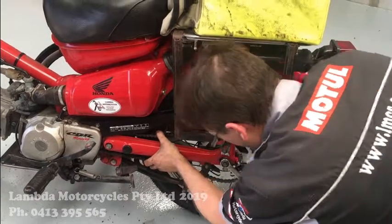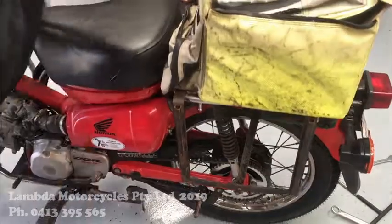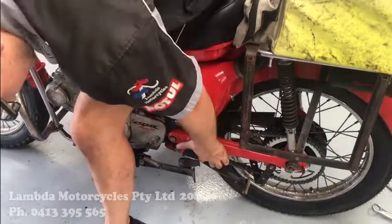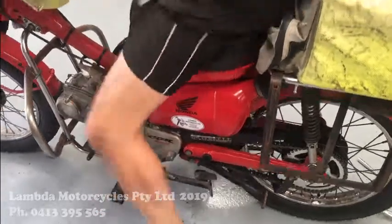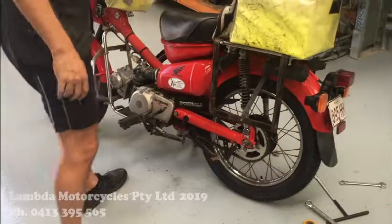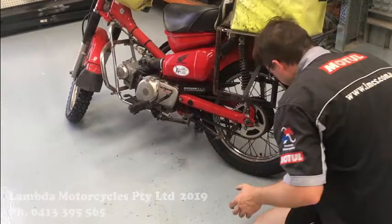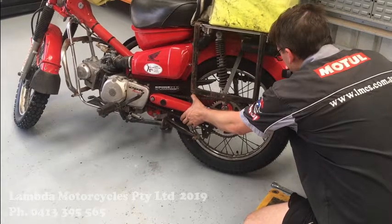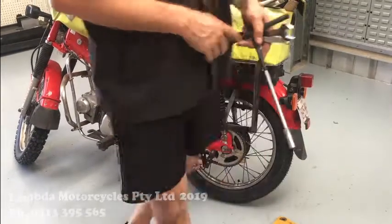Obviously you should always tighten the chain on the tightest spot too, by the way, so I am turning a bit here, and that's much better. That's spot on. That's about how much you need. Because you're going to be loaded, you're going to be going over bumps, you're going to be travelling. And that's that. After you've done that, just make sure that's definitely tight. And just nick things up by holding the chain. Just a nick, because otherwise those nuts will run away on you. And you don't want your nuts to run away on you. Done.